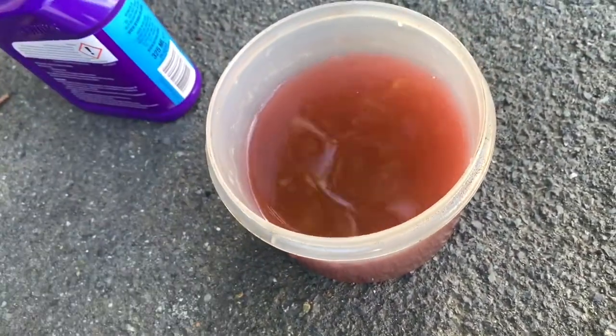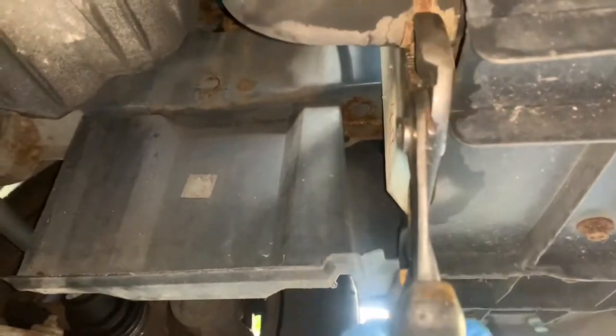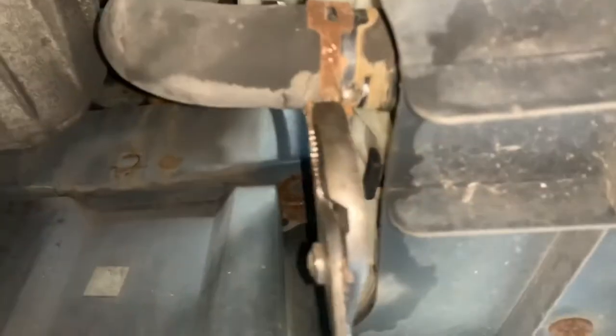Let's now drain the radiator. Right, so being a prestigious car, this doesn't have a drain cock on the radiator that I can see. So we're just going to take the bottom hose off. So you need some decent pliers. Oh, it's moving. Get our bucket under. There!